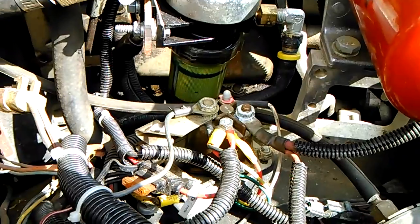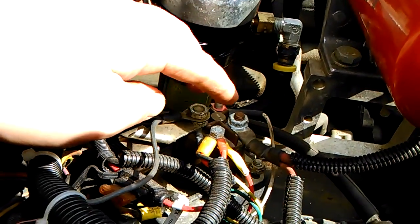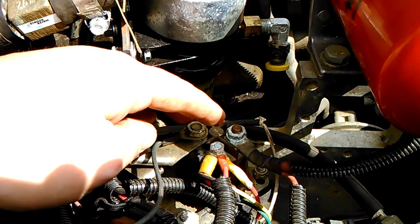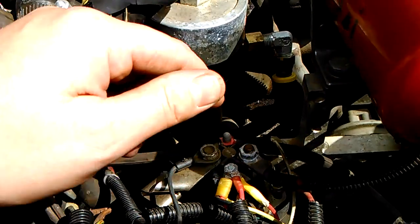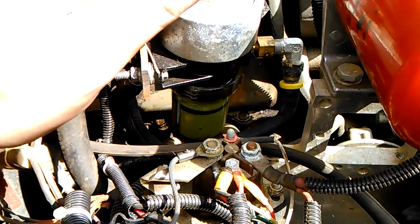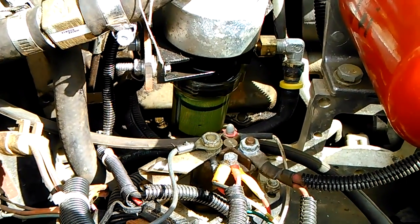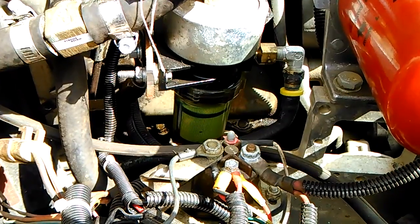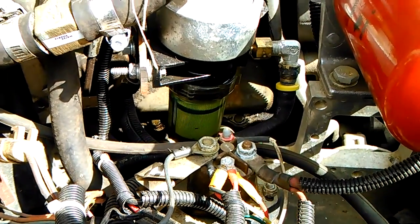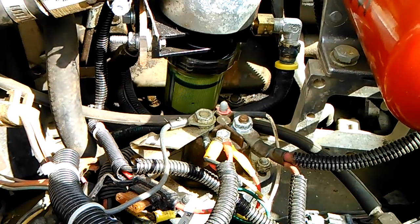But I can't do this with one hand. But basically, you got your positive and your negative terminal here, and with it off, it should be around 12 volts. And with it running, when your key is on, it should be well under 1 volt. I was at like 0.15 with my controller running. So just a quick volt measurement there to make sure it's operating properly.